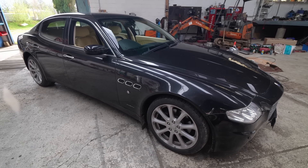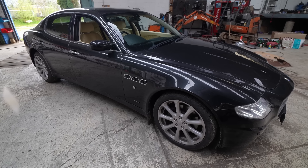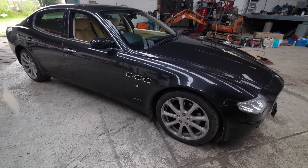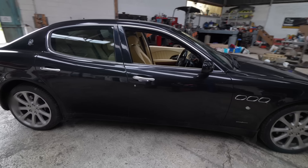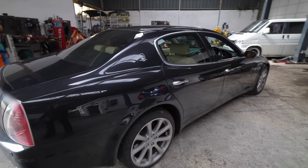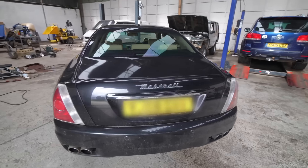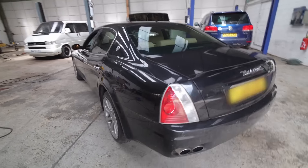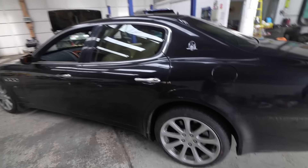When I say taking a small risk, I'm really not overplaying it — it's got a misfire on at least two cylinders. If that turns out to be all on one bank, it could be the variable valve timing cam variators, which is about a six thousand pound job. However, I like taking a little bit of a risk, and this is in pretty good condition all things considered.